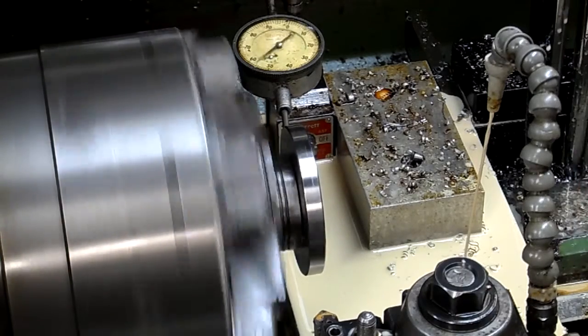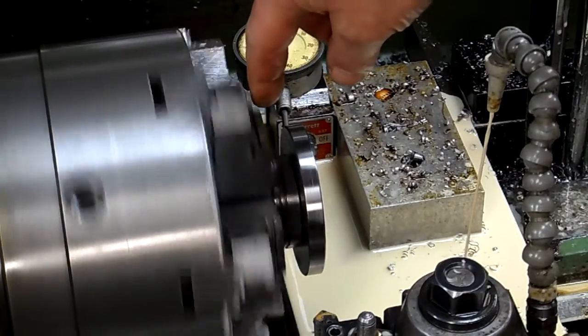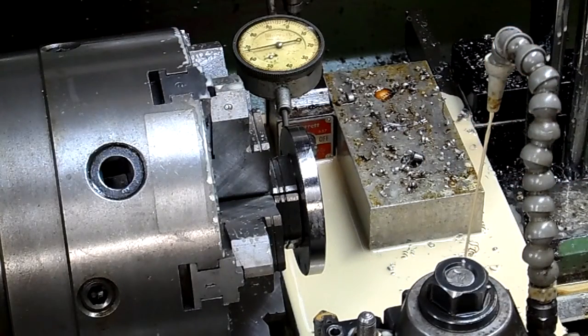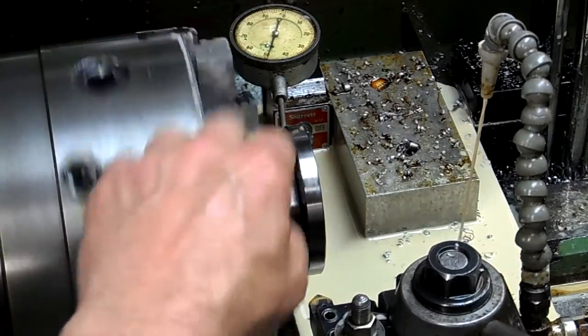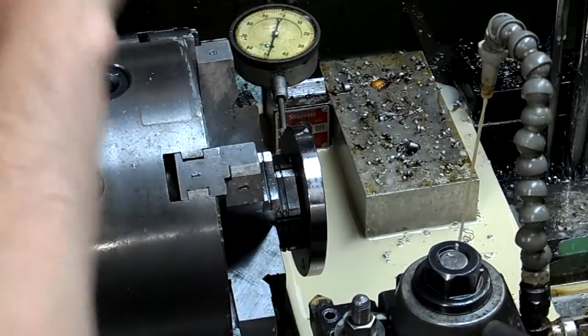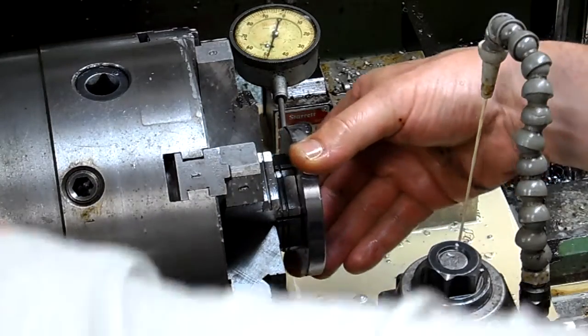It's just angular misalignment. When they machined this half, they didn't put it in the chuck right — there was a chip in there or something — and when they machined the journal, look how off it is. So that is going to be a problem crank forever; it'll never be a good crank. This was a new engine that I took apart. I take the cranks apart immediately because they have to be checked — that just proves it.